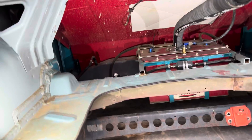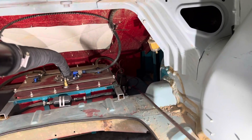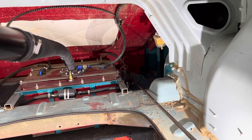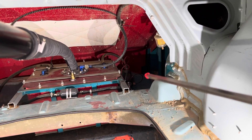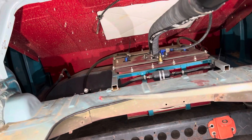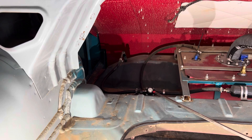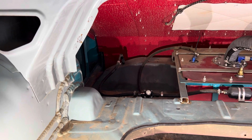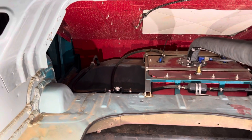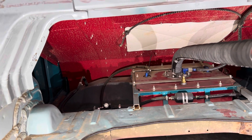If you're going to go with a fuel cell, you need a fuel pump. You can see it hiding in the corner — that's a Walbro 255, through a Corvette fuel filter and a fuel pressure regulator. You have to have a fuel pressure regulator because the stock one is in the tank on the Chevy Cobalt, so you lose it when you remove your stock tank.